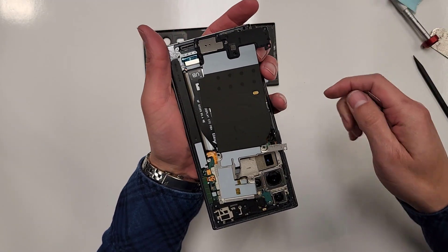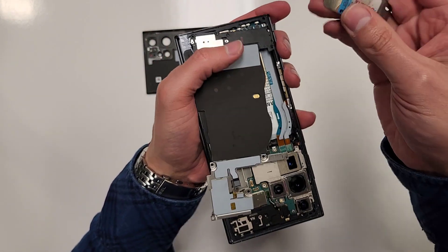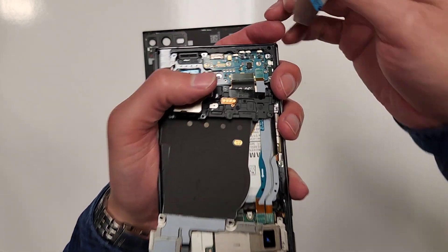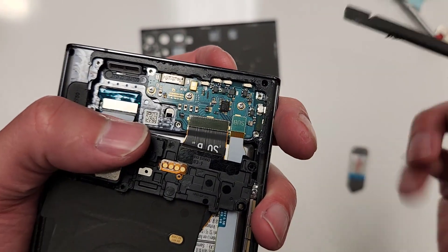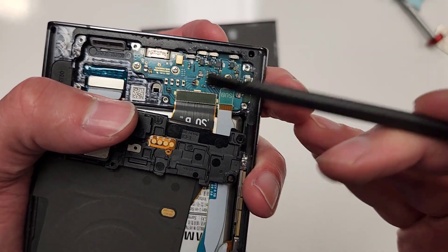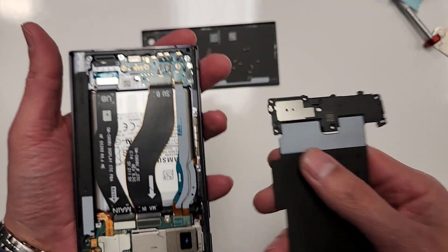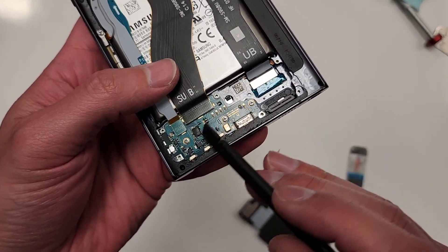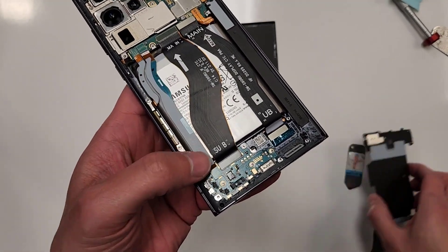Just to be on the safe side — remember, go from the side and just barely pluck up. I don't want to dig underneath because as you see there are all these little microchips right here. You don't want to take this tool and dig in there, because then you end up scratching some of these off and your phone starts not getting Wi-Fi or something. Worst case scenario this piece is replaceable if you damage it — something like the charging port area probably costs like ten dollars.